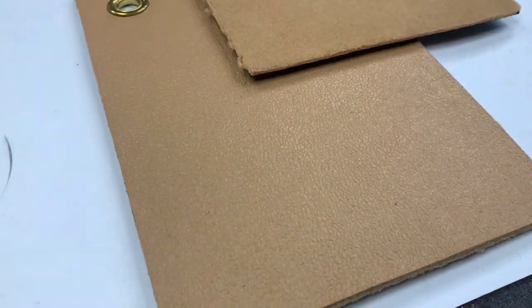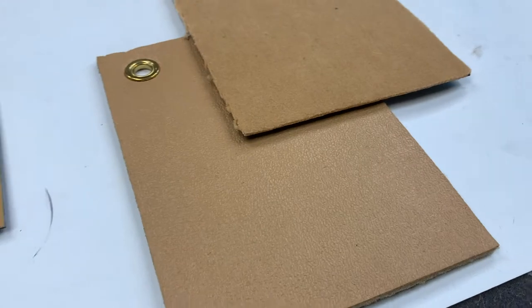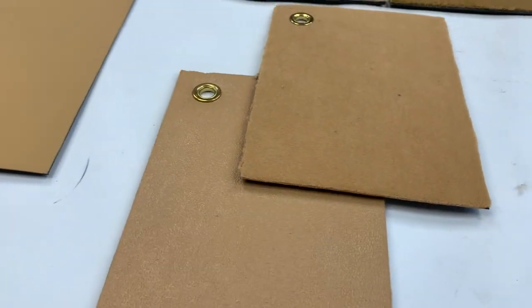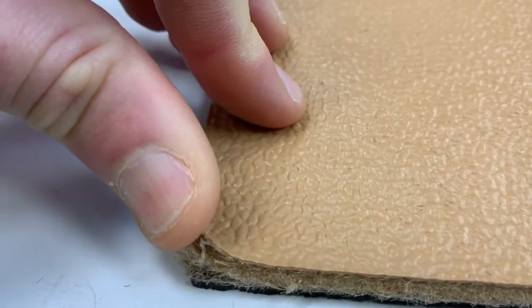For the Jaguars, you have this Hardjura material. Hardjura is commonly used in high wear areas at the back of the car — often the boot and trunk liners were in Hardjura, as well as some of the rear bulkheads. Effectively it's a PVC material with a graining on it to imitate vinyl and leather, and it has a felt backing to it, as you can see.